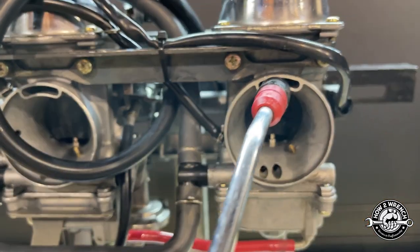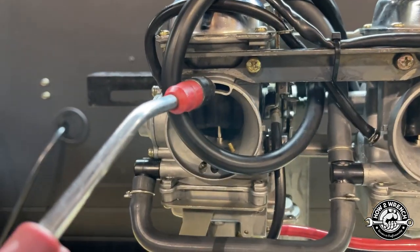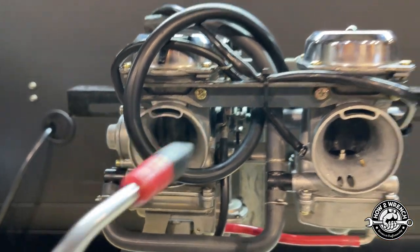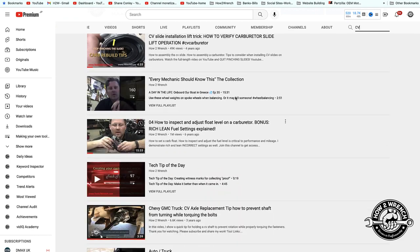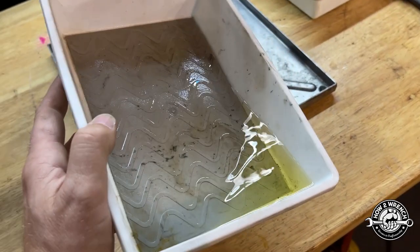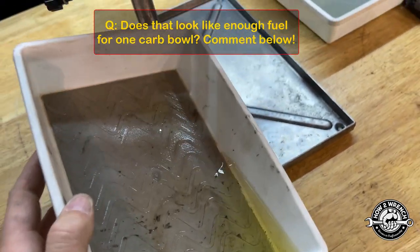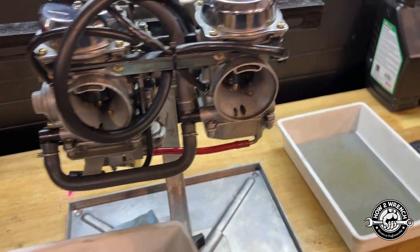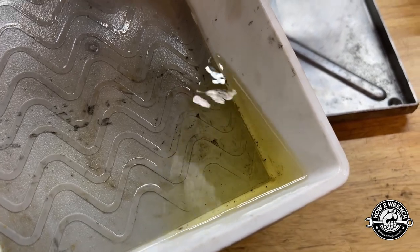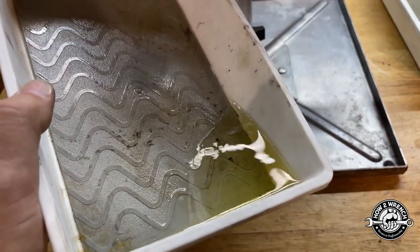The customer just asked us to do some seat repair, but I always like to verify the slides are working even when they don't ask us to do any work in there — it's such a fast and easy test. I've got full deep-dive videos on this in the fuel systems playlist on our channel. What I can do is fill the good working carburetor and measure how much fuel I get out over time to find out whether I'm getting capacity.